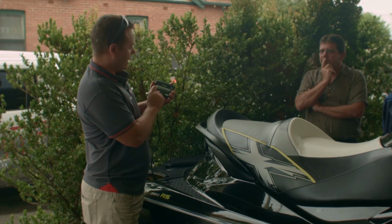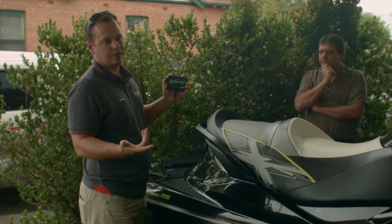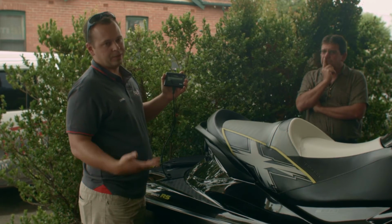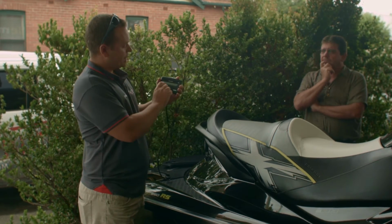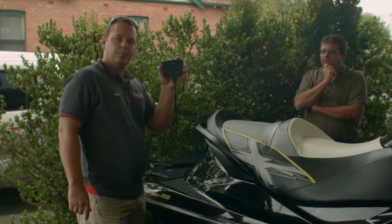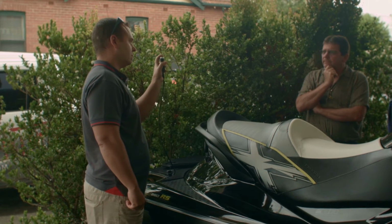So here we've got a base file, which is a 48 injector, 8250 RPM limiter, 35 ignition timing mid, 34 high. So we'll select that. And it actually brings up the torque and horsepower profile. You can see there.